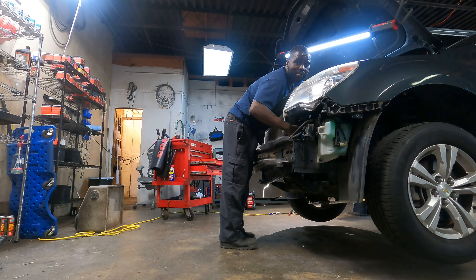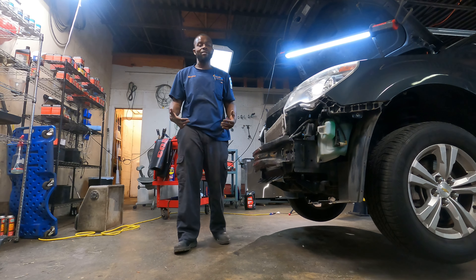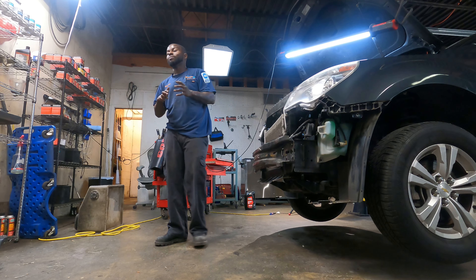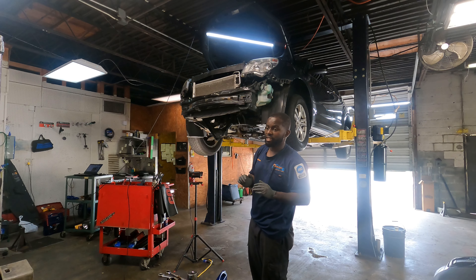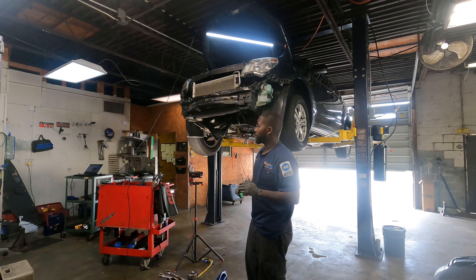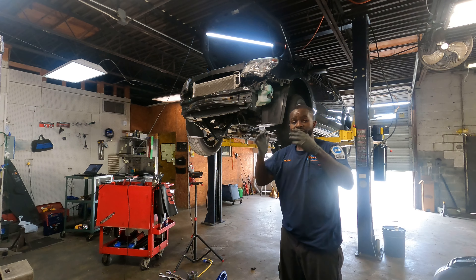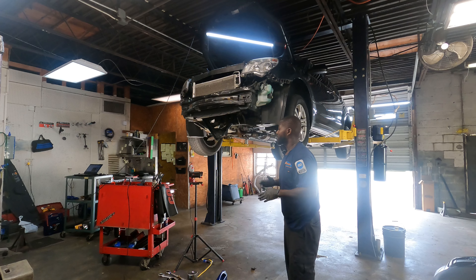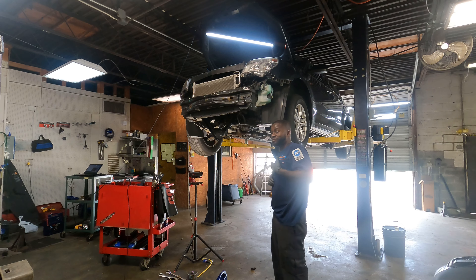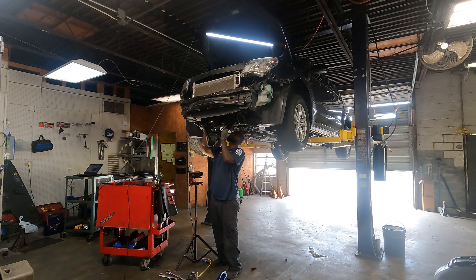What I'm doing now is just positioning the radiator back out of this bottom mount. I'm going to unbolt the coolant fan and then possibly remove it out the bottom, because up top you have the air-conditioning lines that you don't really need to disconnect just to pull the fan out. Just take off the front bumper. I've got the coolant fan on a 2013 Chevrolet Equinox with a 2.5-liter engine. I wanted to give you a different perspective versus the head-shot view — the next one I'm going to try is the chest shot.